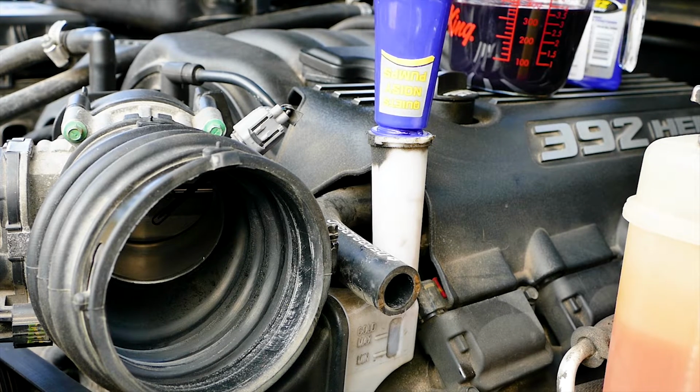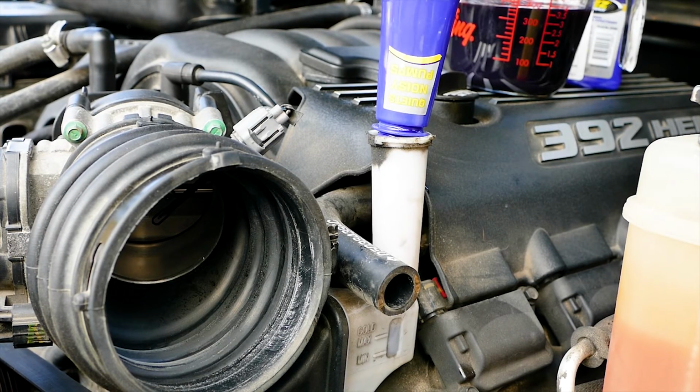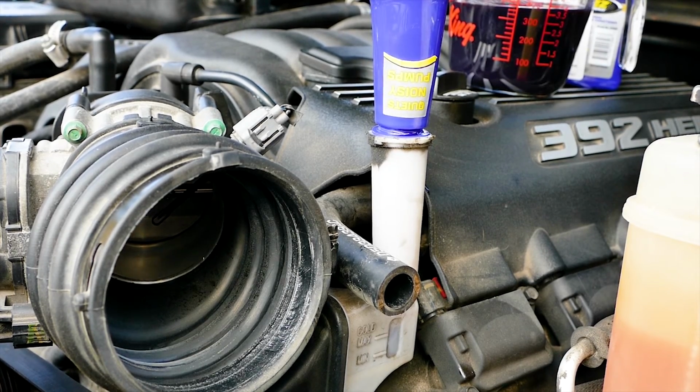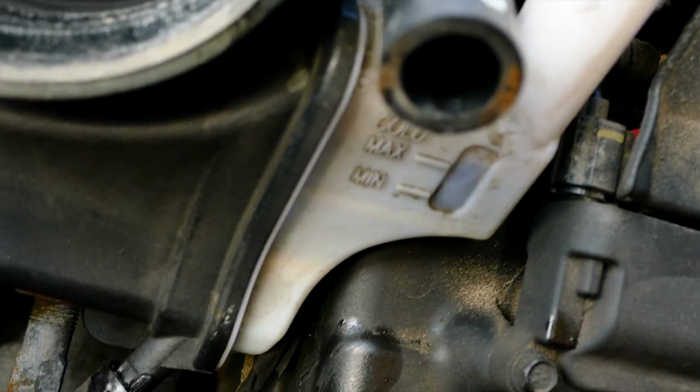But this process requires two people, and you run the risk of running the power steering pump dry, having dirt in the throttle body, or having a mess of things if something gets caught in the serpentine belt while performing this process. Dumping the power steering fluid reservoir tank multiple times with Royal Purple Max Easy is a safe, non-intrusive way that works and gives you peace of mind.